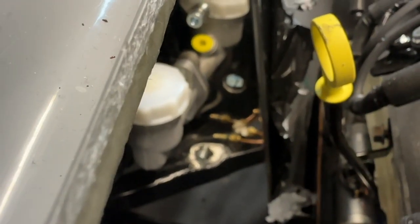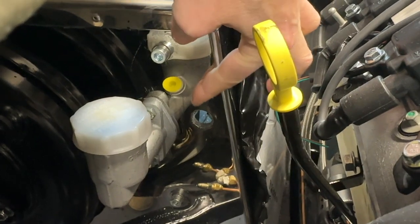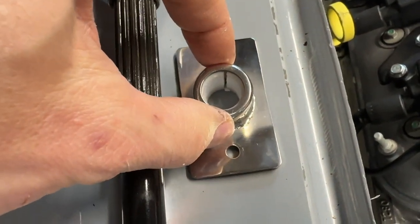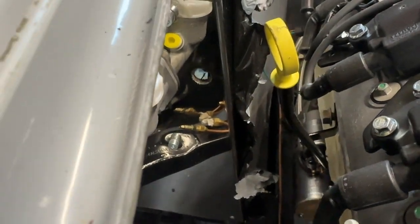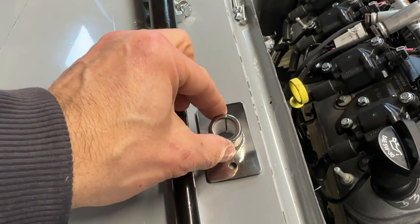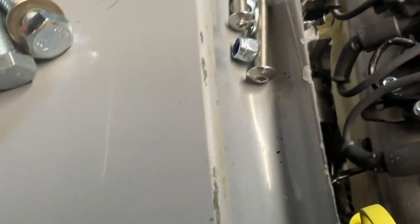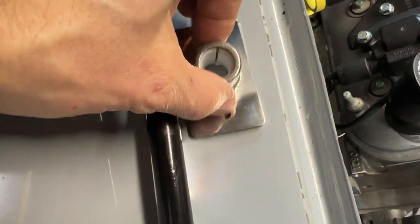Right, the first thing I've noticed is that AK have not made the holes for the steering wheel bracket, which goes here. I think that's because this needs to be very slightly set in place so the steering column isn't rubbing against the edge of the holes. We're going to mount the steering column, poke this extension through the hole, slide this over it, make sure the column isn't rubbing, then mark where I need to drill. It's just held in place by a couple of M5 hex bolts.